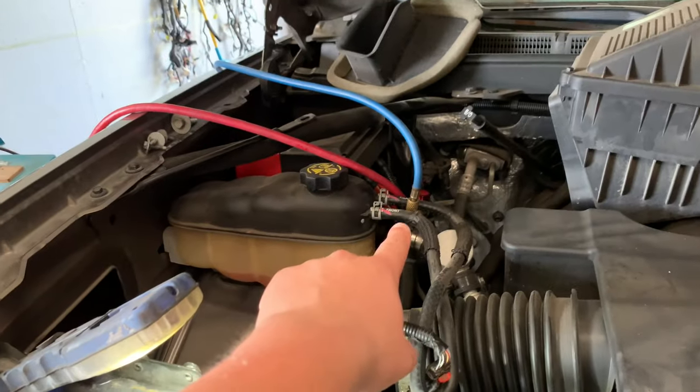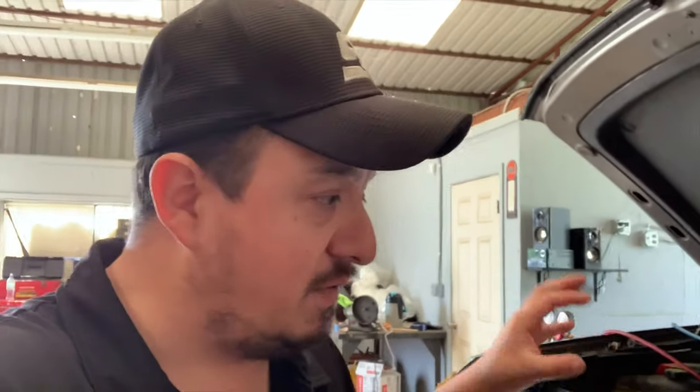While I do this I am running my vacuum. It takes about 22 to 23 ounces of freon, which is about 1.43 pounds — that's how much this vehicle takes. Make sure you vacuum out the system if you're doing this yourself. If you don't vacuum out the system you're going to have moisture and oxygen in there, and your AC is never going to be as cold as it could be. But that's it — we're pretty much done, now we're just going to work our way back.